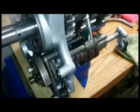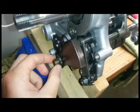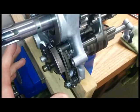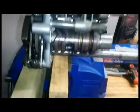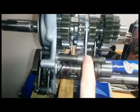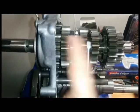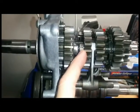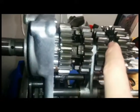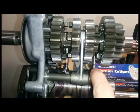There's a ratchet system in there, and this basically moves up and down when you turn the gears — you'll see that a bit in the video. It's all spring-loaded. I didn't really want to pull it apart because there's nothing wrong with it; I don't want to upset things that don't need to be upset. You've got your shift drum here, which is responsible for the shift pattern, and it moves these shift forks. You've got this pattern — these are splined on the shaft but can move left and right. You can see the dogs on each end of them, which engage with the gears. And if you look, you can see the other two shift forks just behind — there's one there and one back there too.